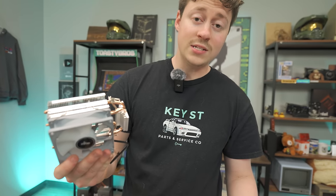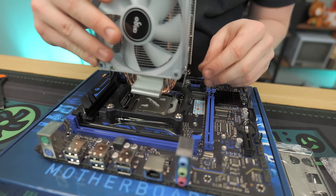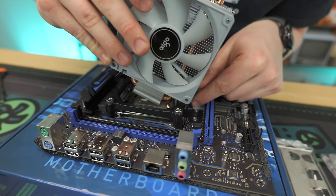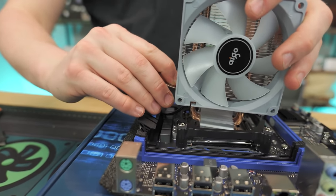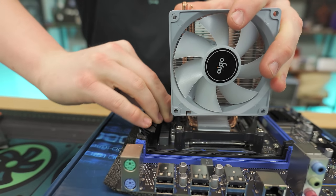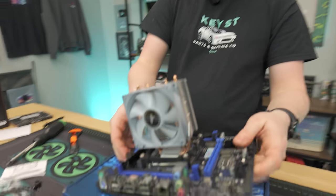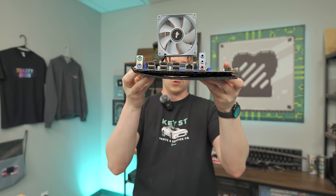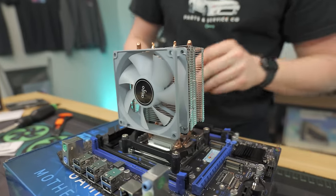You can put the thermal paste on however you want. These coolers are really easy to put on — they're tool-less for the most part. Once you have this bracket installed, you're basically going to take the fixed side first, get it on that center piece, and then push down really hard. It takes a lot of manpower, but as you can see our cooler is on. It looks a little crooked — the cooler is honestly a little bent, which is usually how it goes with these budget options.